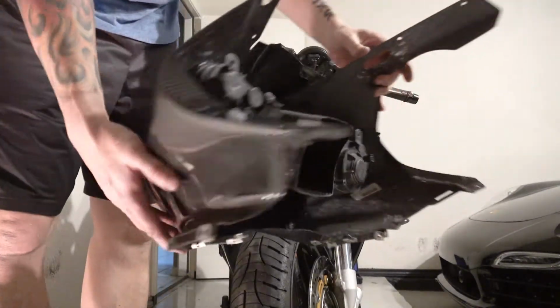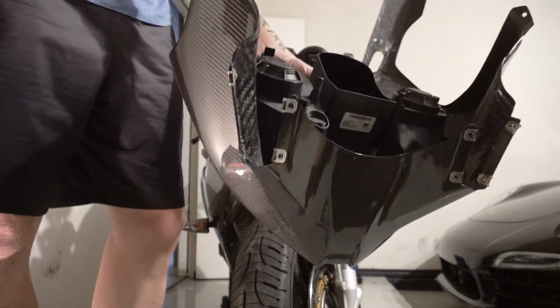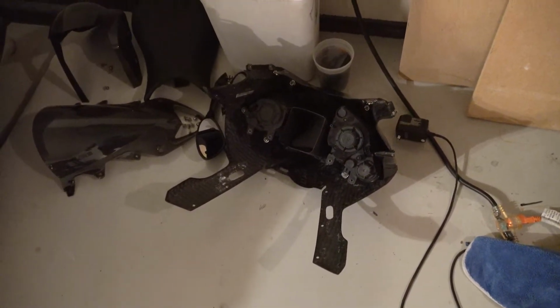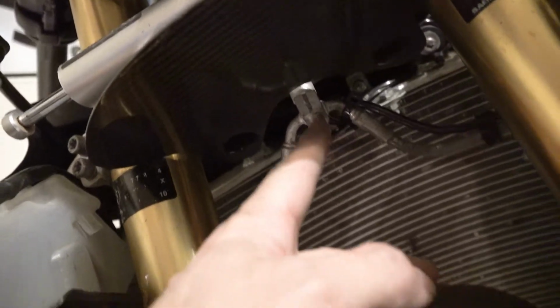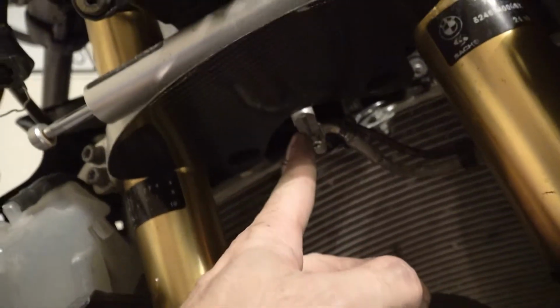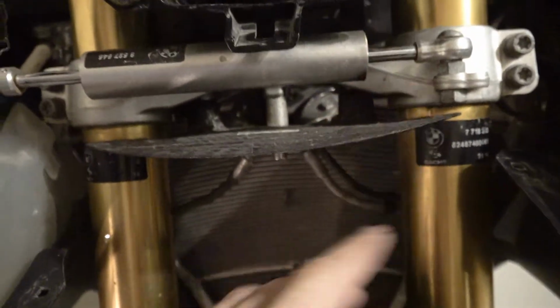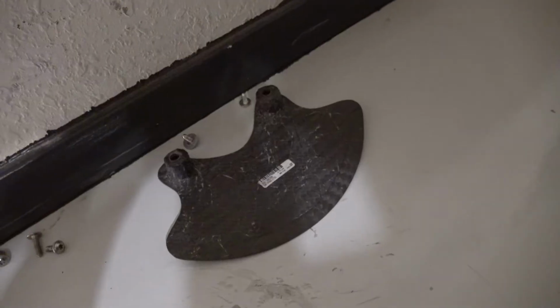So that's the inside. You have to remember that little inlet piece is just floating in there too. Make real sure it's off to the side, not going to get stepped on. I've got a few more fasteners. I've got one bolt here holding the brake junction off, and then two screws that hold this under piece trim. So remove those. Two screws and that's off.